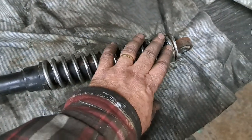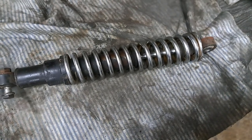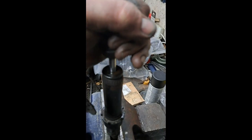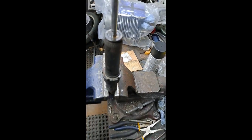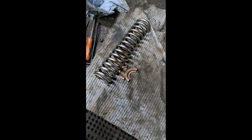I've got to compress that spring and get those little keepers off of there. The other shock is in good shape and it's worthwhile cleaning up, so I won't know if this one is until I get it apart. That shock with the spring off it is still good — if you push down it will compress quite easily, but when you go to pull it out you've got to really pull hard to get past the oil going through the shuttle valves in there. So that shock is still working. I'll get on with this, clean it up, and show you what I've got with the two of them when I'm finished.